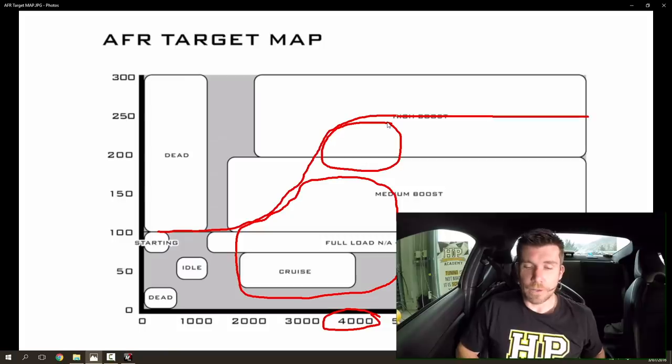The reason for this is that as we open the throttle further and the engine makes more power and torque, it also produces more exhaust gas energy which helps spool and drive the turbo faster. So we find there is a certain point where, when actually driving the car, the engine will tend to transition very quickly through this particular area at higher RPM and higher boost pressure. We're not going to be able to sit steady state in this sort of operating area. In this instance I would normally concentrate on my steady state tuning up to around about 200 kPa or one bar of positive boost pressure.